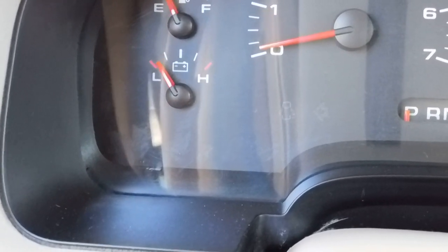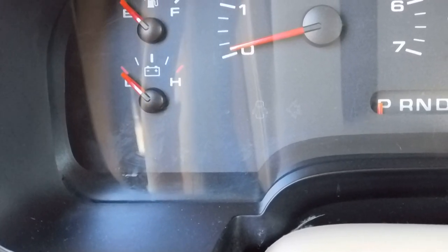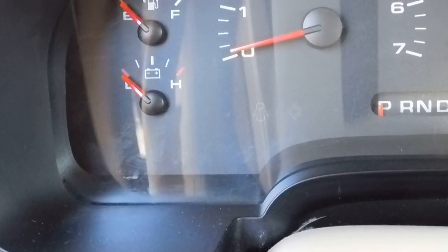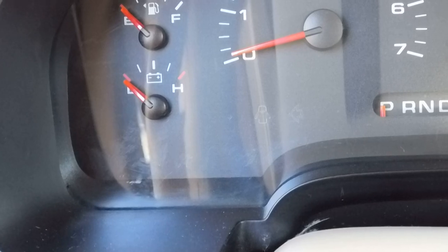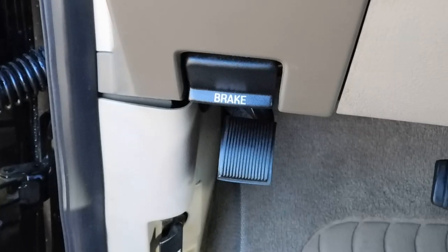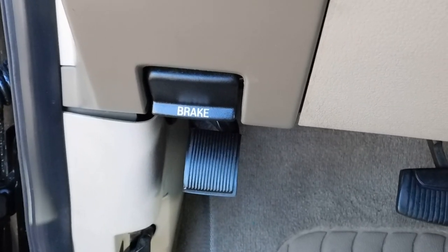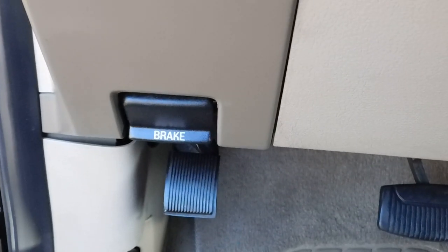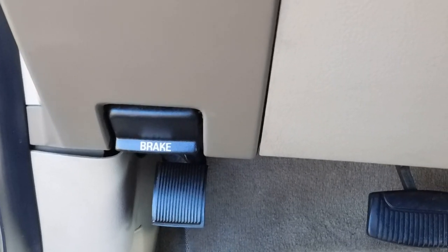The first thing you guys have to do is make sure you check the brake fluid level — that's one of the most common problems. The brake pads wear out, the fluid level goes down, and that triggers your light. The second most common cause is your parking brake being partially engaged, which will also trigger the brake light. Otherwise it could be an electrical problem with your wiring, but in this case that's not the issue.